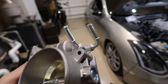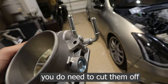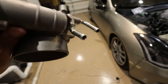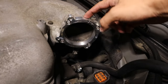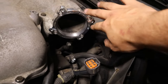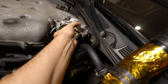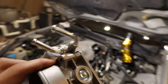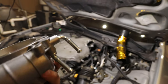One thing to note: if you buy from Concept Z, the throttle body is going to have coolant ports and you might need to cut them off. I have a cutoff wheel in case I need to. If you don't have one, keep in mind it might be necessary to cut them because they could hit the intake plenum. The kit fits really well — it comes with a gasket that goes in between, and it also has an O-ring, so once you bolt up the throttle body you're done. The coolant ports are actually in the way of installing the throttle body onto the adapter, so I'm going to go ahead and cut them off.